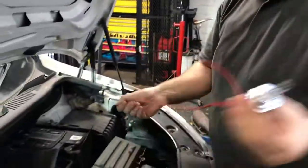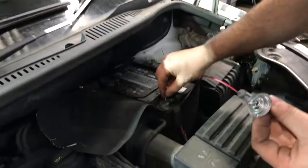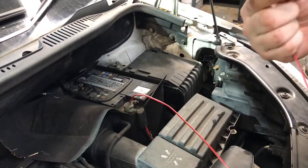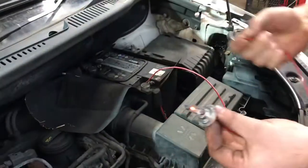All I'm going to do — you've got two prongs on the bottom of an H7 bulb, you can pull this out of your headlight if you need to — just tie two bits of wire around it so it's in series. Use one end; it doesn't matter which end because it's a coil. Then you just go to your positive terminal on your battery if you're looking for a negative on the other side. Do your quick test and your bulb lights up.